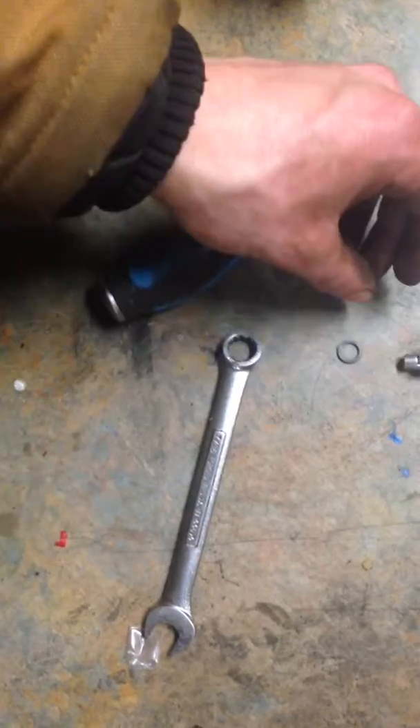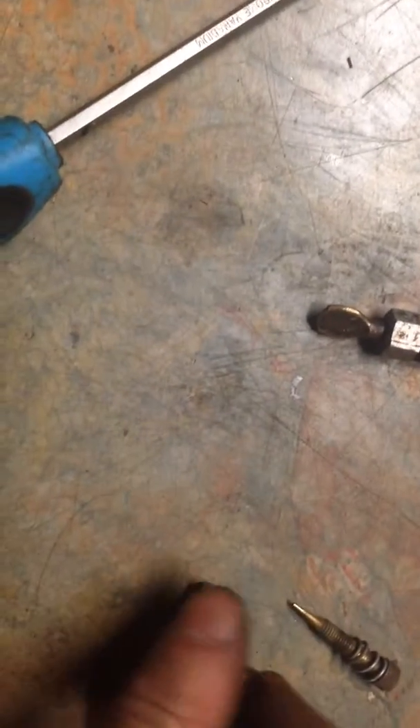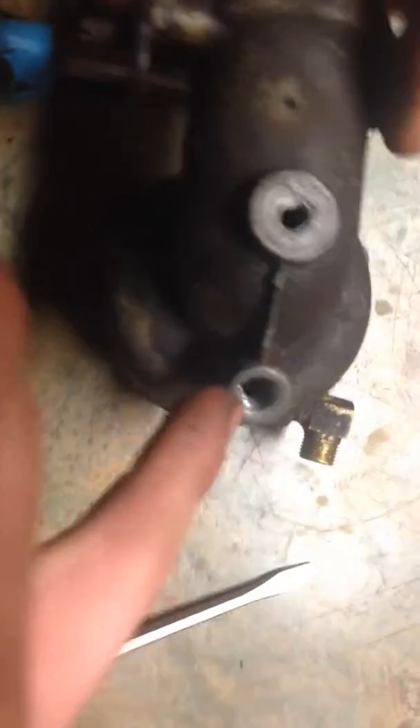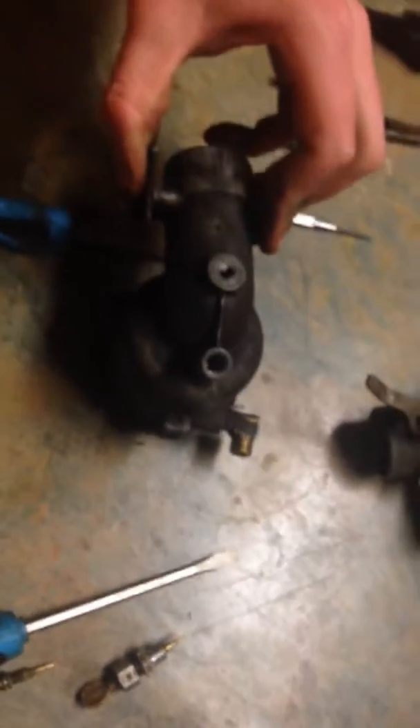What I want to avoid — like what happened last night — I just pulled the needle out. I think these are actually slightly different lengths, so I'm gonna pull it out all the way just to be safe. Actually they're the same length, but just to be safe I'm gonna put this on here, cause I don't want to wrench that needle onto that jet. So just put the little ring on and tighten that down. You can see there's the hole that goes up to the carb bowl, and the fuel just falls down in between here. This needle determines how much is gonna go up into the throttle body.